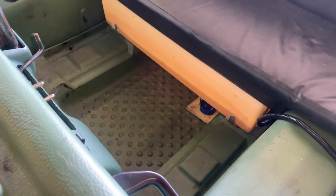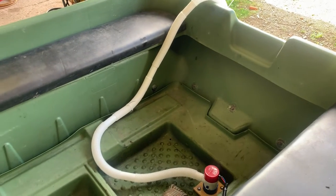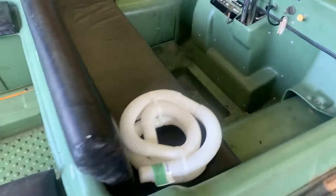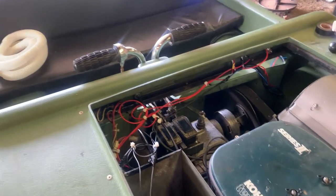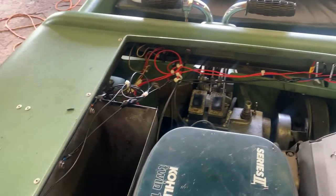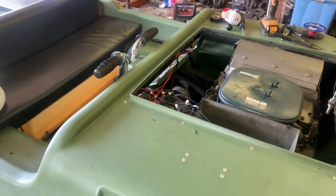It's the next day, out in the shade, just tidying up. This is where my front bilge pump is going to go — down right here underneath the fuel tank, tucked away. The rear one I've got right here; I might change how it sits but for now it's working out pretty cool. You can see my switches up front. I'm getting ready to fix up the front pump wiring. Underneath the hood it's not too bad, a little messy, but I got it done. I just picked up some new drain plugs and I'm hoping today or tomorrow to test her out.